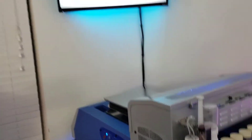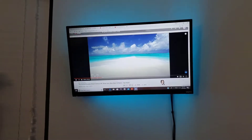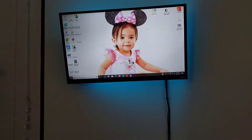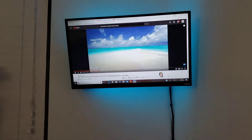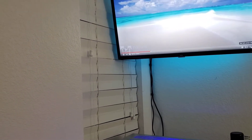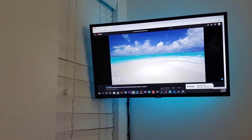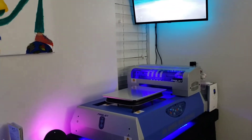After I got this printer, I had to get another computer because you can't run two printers off of the same computer. This screen right here — if I exit out of this — is a whole other computer that I can run the RIP off of. And on this side, this screen is the same thing, it's a whole other computer. So basically, if you have two DTGs, you can't run them off the same RIP. They have to be on two different computers, two different RIPs.